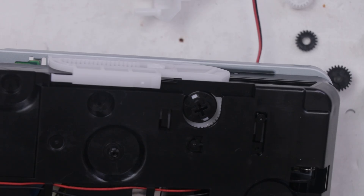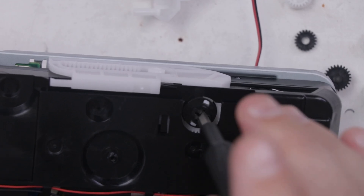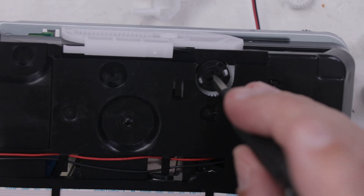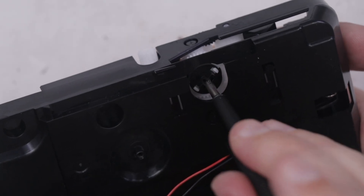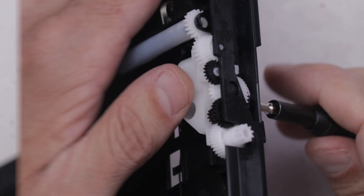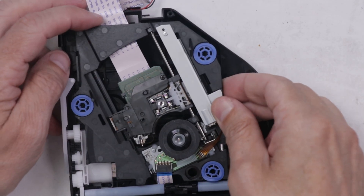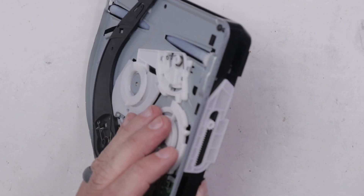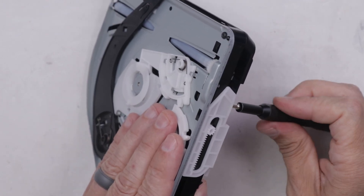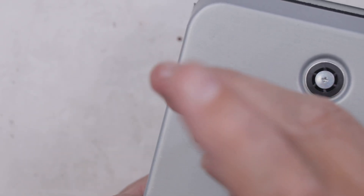If we look at a known good drive, which I happen to have right here, we can put our screwdriver in and see how easily and how quietly it turns. So the obvious answer is to remove the motor from this disk drive and put it into the broken one. Here is the manual eject — we can turn it very easily both ways, and everything turns nice and freely. Now I want to get the laser back in and test it at every step along the way, just to make sure it's going to work once we get it all put back together. Let's install the bottom plate and test it one more time with the bottom plate on. And that is all turning freely. Now I'm just going to get the rest of this disk drive put back together, and then test it once more before we get it put into the PS5.